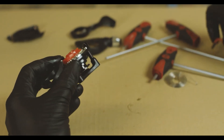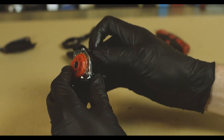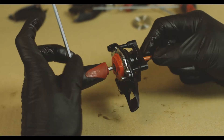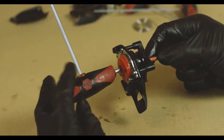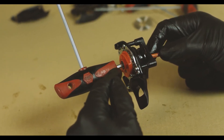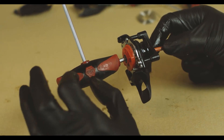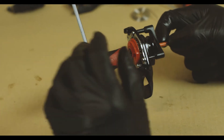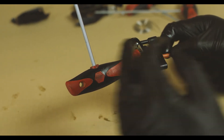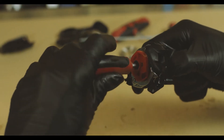The first thing we have to do is flip the shifter over and put the T25 in the bottom through the claw, then take the four millimeter into the pivot bolt. This part can be tricky because there are bearings pressed in on either side. With the T25 hooked up and the four millimeter on the pivot bolt, unthread while watching the pivot bolt come out on the left and applying more pressure on the right, so everything moves outward toward the spool rather than pushing the T25 bolt out into the claw. There's a little knurling on the pivot bolt so it bumps as you turn, but you can power through that.